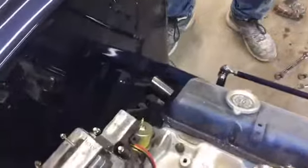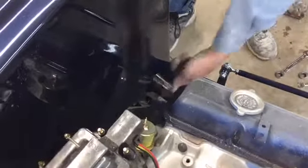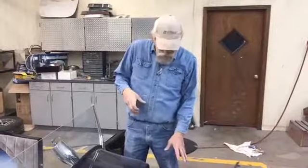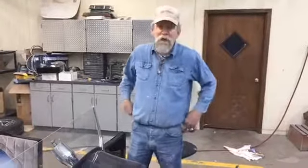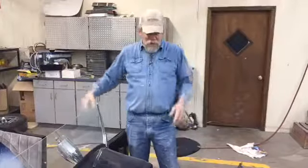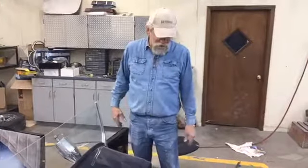What we do is we put a piece of 2-inch ID PVC tubing straight through. This hole will be a little bit bigger. The hole on the floor will be a little bit bigger. I'll leave that PVC hang out on both sides about this far. Get my column put in. We do it here on a jig, but our jig is nothing but a shortened frame that's got wheels on it that we can move around, that's got that steering box on it.